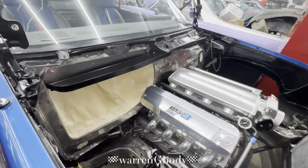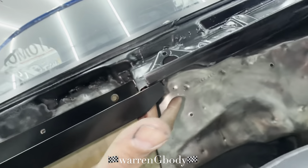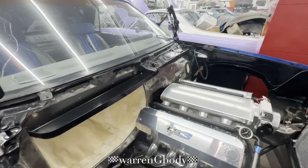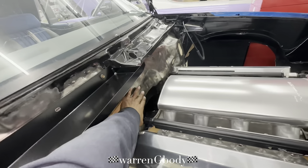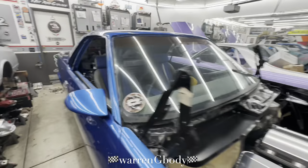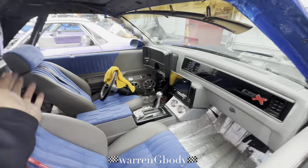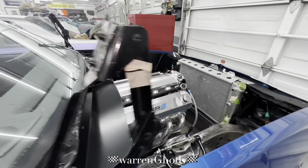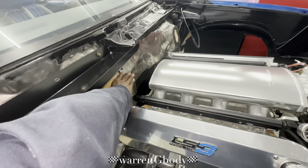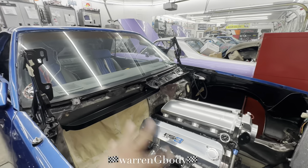There's a notch in that plate and it fits right up inside in this area here perfectly. I'll leave the link to his videos. I'm gonna have to heat this area up — everything in my Elco is just mocked up, nothing is secure. But you want to make sure everything is out because I'm gonna have to heat this up and massage it back to being flat, then pound it out until it's nice and flat and tack it all in.